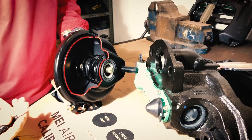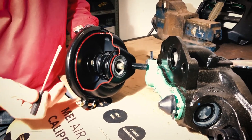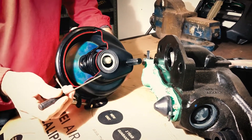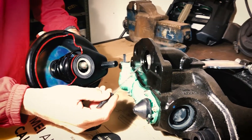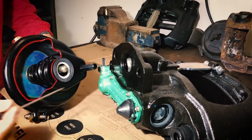When fitting an air chamber to a caliper, we need to be sure that we prevent any water ingress to the caliper. First thing to check is the face seal. The face seal must be a minimum of three millimetres tall from the body of the air chamber, and the face that it connects to on the caliper needs to be clean, free from dirt or corrosion.